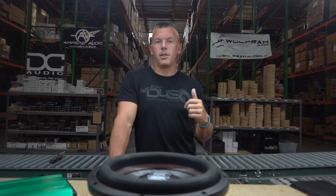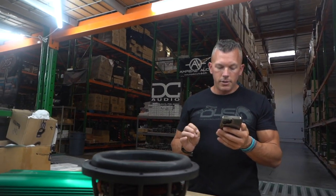It also changes a bunch depending on if you have the windows down or doors open. I don't have a sealed enclosure so I can't tell you that difference directly. Generally, a sealed enclosure gives you more control on the lower end of bass. My last box with the six 18s was a fourth order — the sealed side was where the subs were mounted in the back wall, calculated to be sealed, but inside a ported chamber behind the driver's seat. You can have one-to-one, two-to-one, or three-to-one ratios — all different kinds.